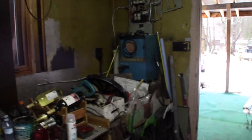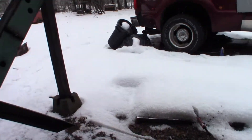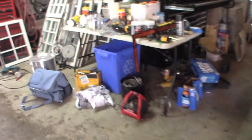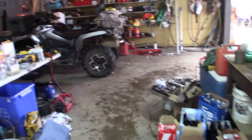Another failed attempt at trying to get practice in here — the welder is not working. I can get it to strike an arc periodically, but I don't know if it's slipping into a duty cycle early or something like that. I got a couple of roots in, that's it. I was penetrating at the end there when I finally got it going, but those 6010s like to penetrate — that's their job. Anyhow, there's a 50 amp plug here right on the bench. So I'm going to hopefully get my other welder set up on the 50 amp power and then we are golden to weld.